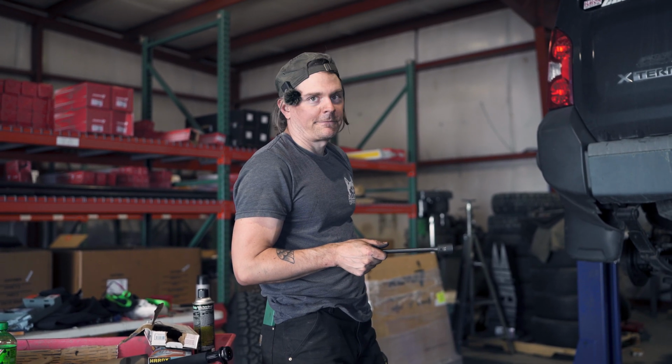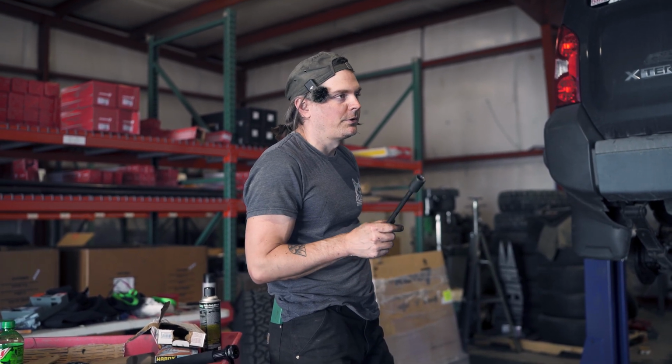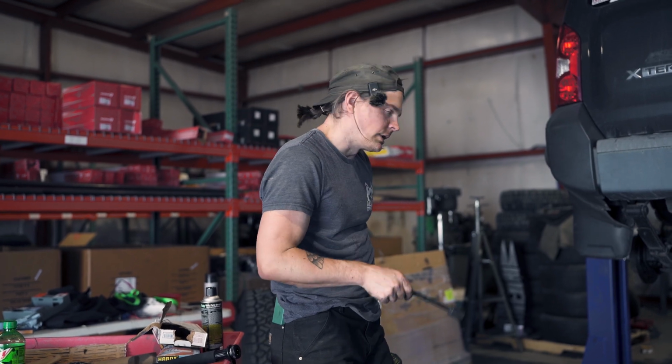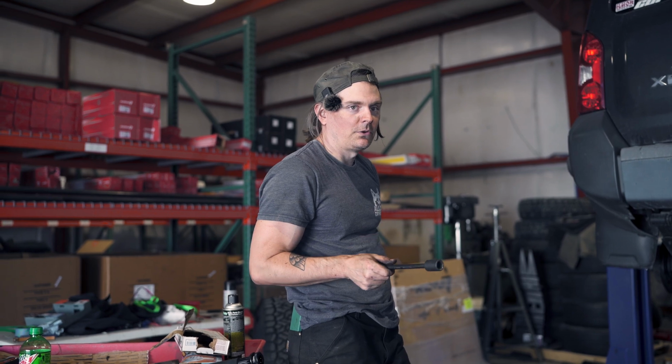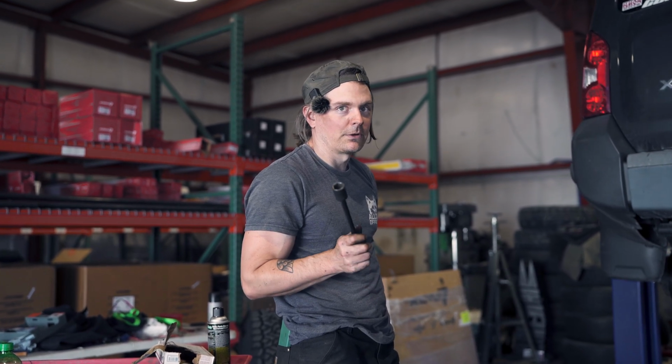So now we're going to move up front. We're going to pull the wheels off, pull the CVs, drop the R180, slap the new one in. We'll see if we can do that all in an hour and a half, because it's about 3:30 right now.